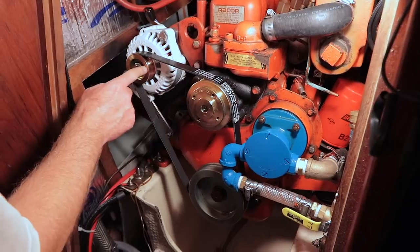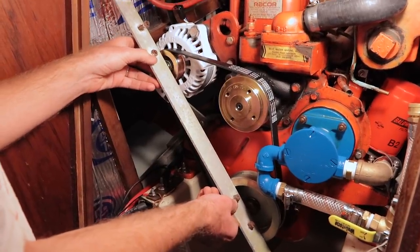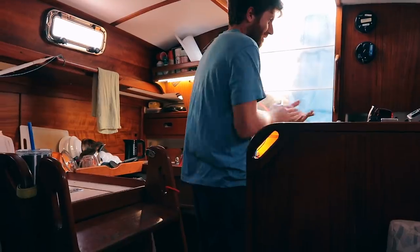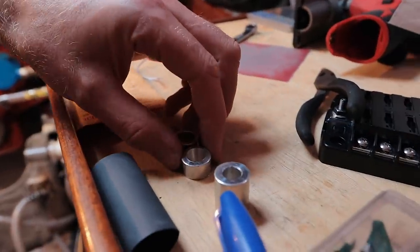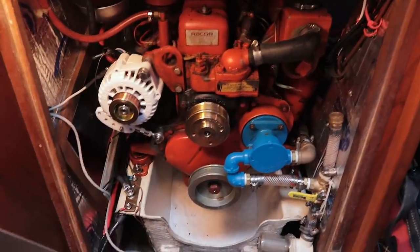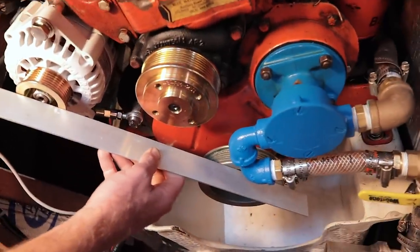I need to go get a straight edge. We're going to make sure it touches both sides of each pulley. There's no rocking there, but there is definitely rocking here. So that needs to come a quarter inch forward. We have a number of little bushings that I've made of various sizes to get both the bottom and the top of the alternator in alignment with both pulleys — in a three-dimensional space, which was tough because we only have two mounting points. There's the tiniest bit here, and here there's none. That's pretty freaking good.